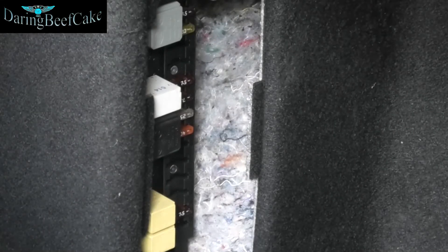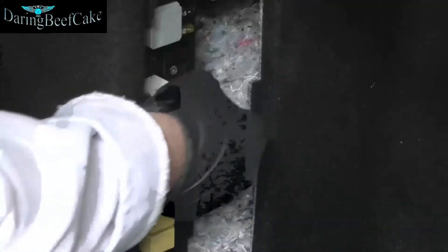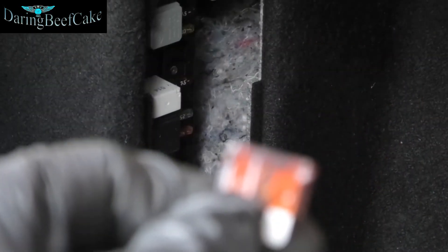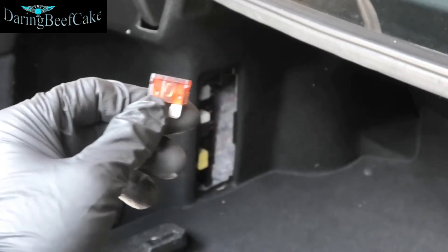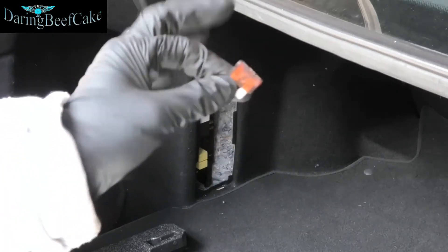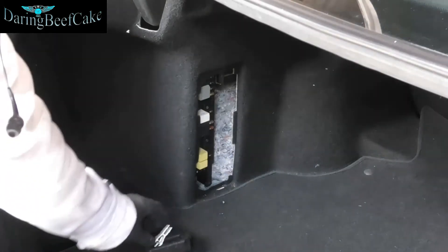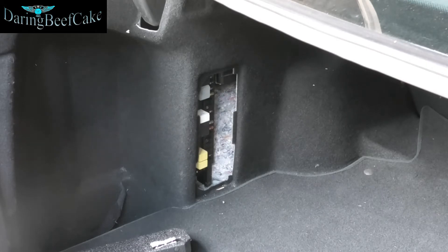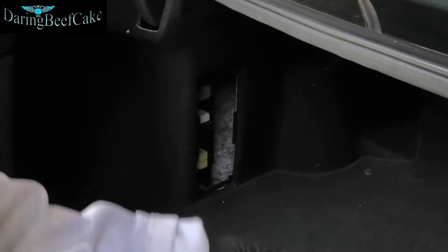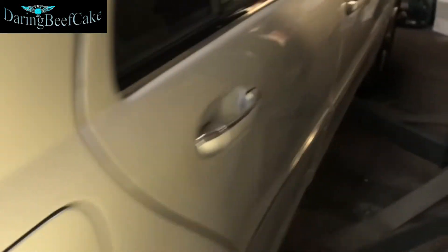I think it's also connected to the alarm siren of the car. So if I just remove it - we have a tool here - fuse eight. I can see fuse number eight here is actually blown. Now the question is why did that blow? I've already put another one and it blew again, so it's not as simple as replacing it. In some cases it will be, but in this case we might have a faulty siren or a faulty receiving unit for the remote.